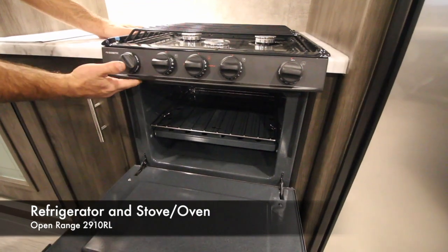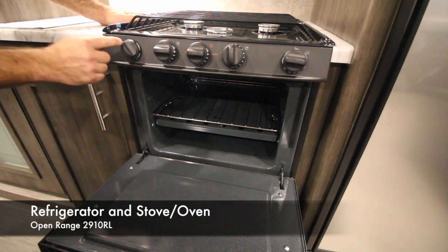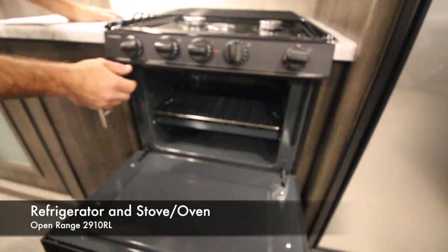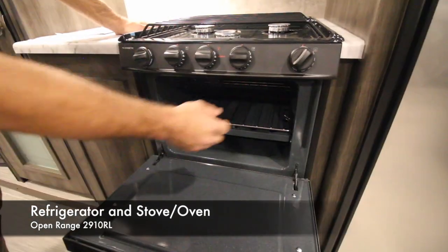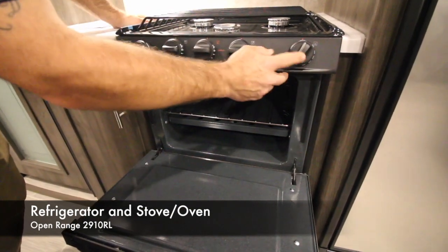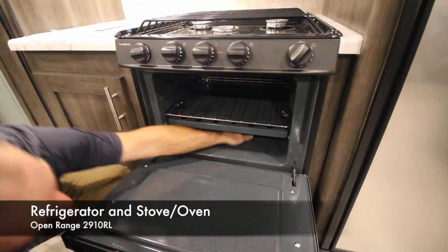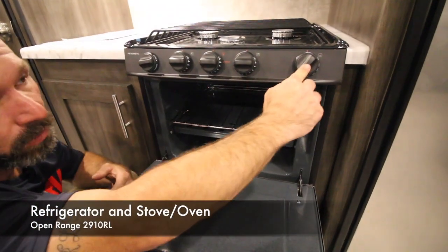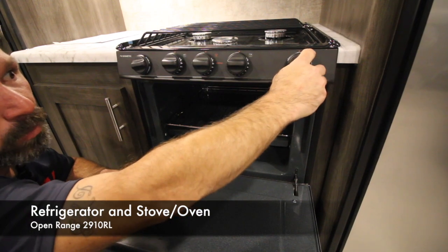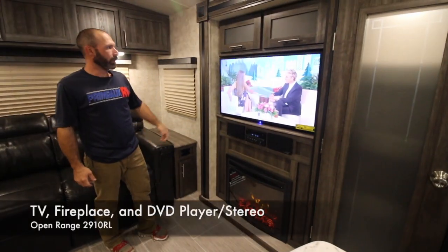On the stove, pick whatever burner you want, turn it on — on this side you have a spark igniter, turn it and when the gas is hooked up it'll light that burner for you. For the oven, there's no spark so you have to light it yourself: put it on pilot, press and hold the button, light it down at the pilot — once you see the little blue flame, press and hold for about 10 seconds to let it purge, then you're good to go. When you're done baking, make sure you put it in the off position so the pilot light doesn't stay running.